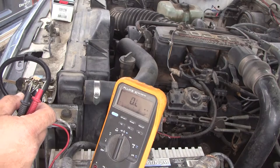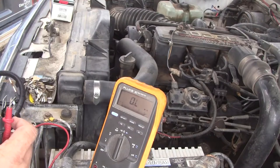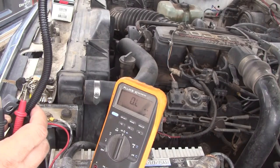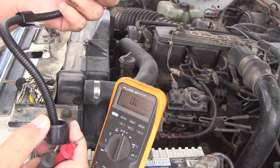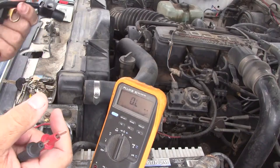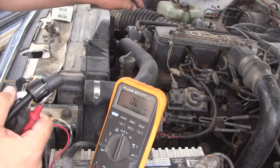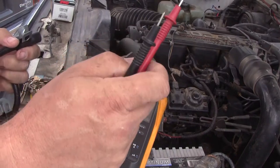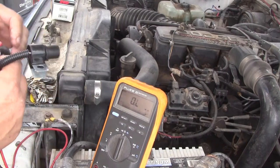The new one reads 2.6 million ohms; the old one is half an ohm. The original part is an engine speed sensor — technically called a crankshaft position sensor in some places, but it's really just RPM. There's a notch that travels around the bottom and it gives the computer RPM, and that tells it the engine is spinning, so it will turn on the AC and the alternator. I confirmed the old one is bad two ways — half an ohm, and 5V divided by 0.5Ω is 10 amps. Something is clearly wrong.